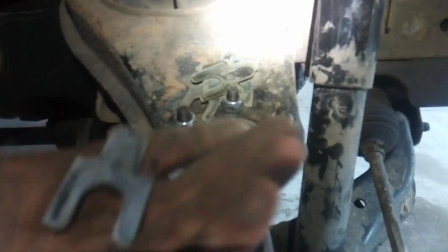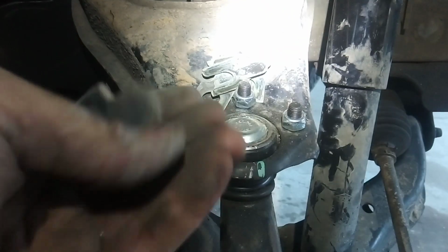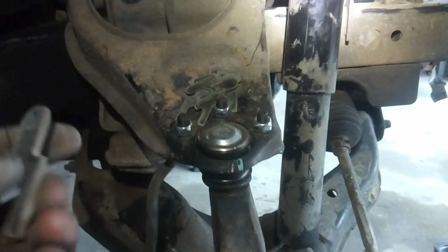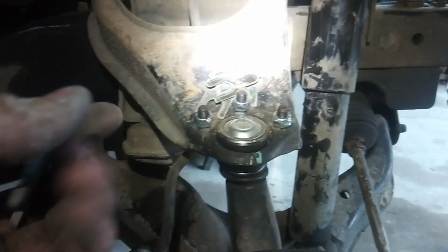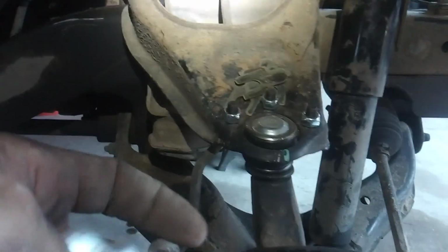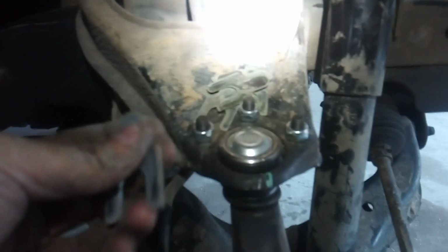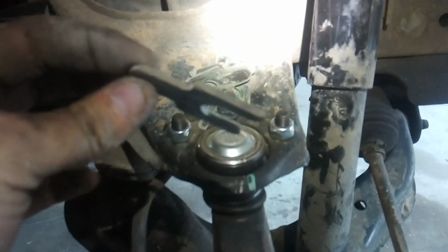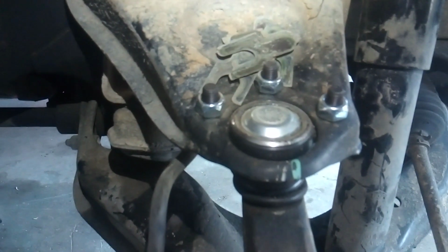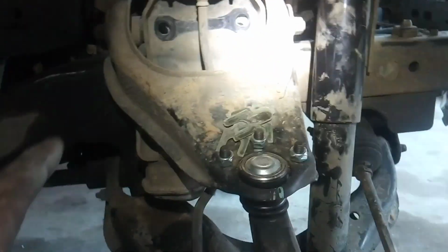So these go in from the factory, or maybe at some point down the road your car went to an alignment shop. This one has had a front end collision really hard, and I think it actually tweaked the frame, I can see. And someone tried to fix it up, and I got suckered into buying it. So this might have been done by an alignment shop at some point after the frame got tweaked. But I'm going to make sure that the big thick shim goes back here when I bolt this back on, so that the camber isn't skewed.